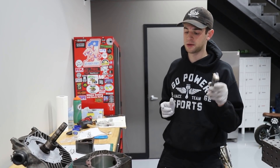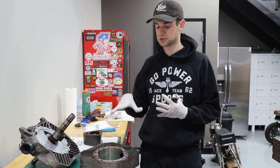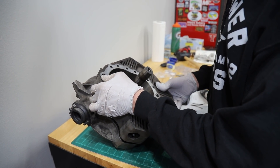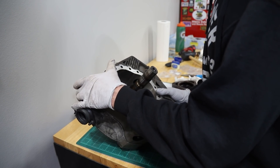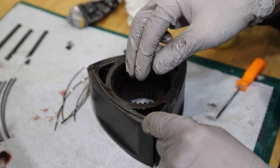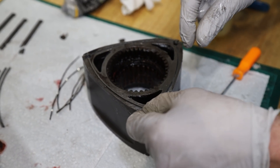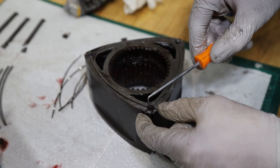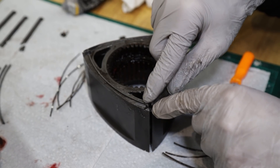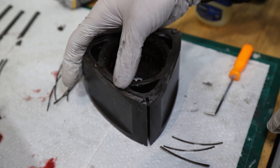This is Yamabond - it's used for two-stroke casings as a sealant. Since we're not really sure if these casings are warped or have any imperfections, we're going to use a very small amount of Yamabond on the outside. The side seal is nice and springy and now we're doing the corner springs. These have two springs on each corner - one faces down and then one goes on top facing upwards. Then we have our corner seal that goes on top. It springs nicely. Before, these were not really springing very much, so this is a big improvement.